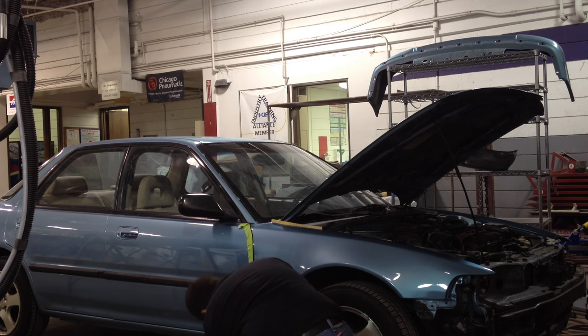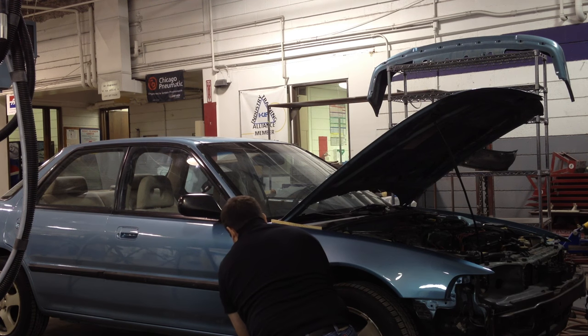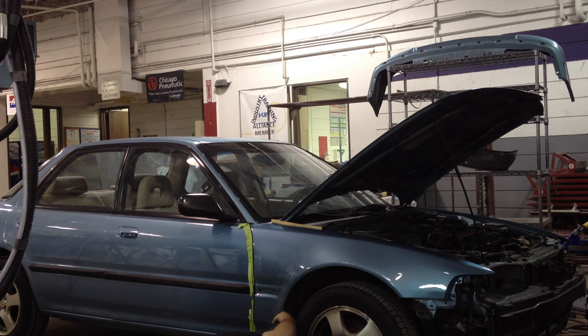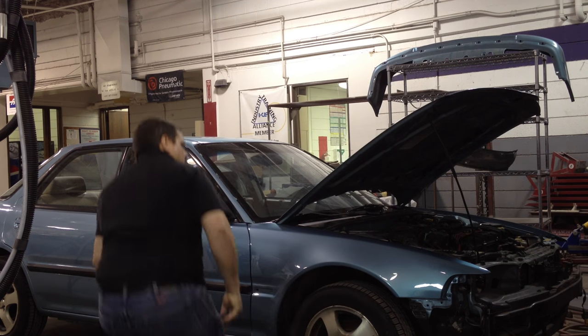Now you have the fender adjusted to the door, and all the front bolts you still wanna leave loose so you can adjust it to the hood when you shut it. A thing to keep in mind: don't throw the fender on there and just open the door wide open, because if it's too close it's gonna hit, it's gonna ruin your paint, could dent it again. And the hood — when you go to shut it, just don't let it slam, because if that fender's in too far it's gonna land on top of the fender. Always open your door slow until you see the adjustment's gonna work. Lower the hood real slow so you can tell what's gonna happen before two panels hit each other. Once you have everything adjusted, the gaps look good, the flushness looks good, then you can go around and tighten the whole fender — tighten all the bolts and nuts and make it secure.